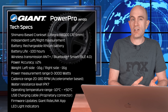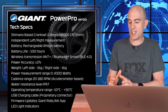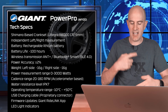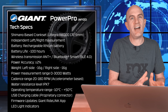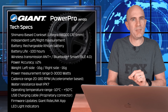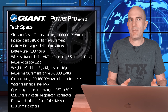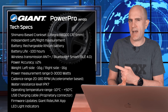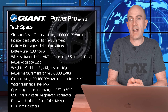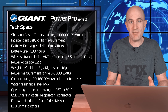If you recall the 2019 model, you may notice a drop from a claimed 150 hours battery life down to 100 hours. However, testing with a rig in the garage with the pedals moving non-stop, I only got 114 hours out of the previous version. So 100 hours probably isn't a big change — it brings things more in line with real-world usage. For context, pedal-based power meters are around 40 to 60 hours, so that's not too bad. A recent firmware update has also addressed a battery drain issue I encountered and reported to Giant, so they're on top of things. I've been running that for a few weeks and everything is okay — a good reason to keep your firmware updated.